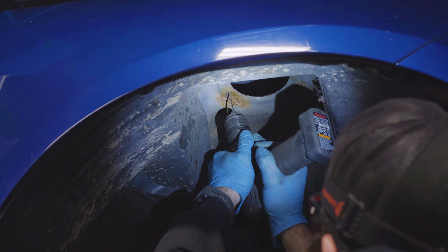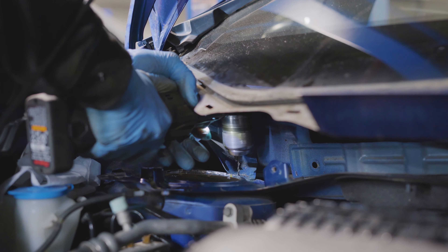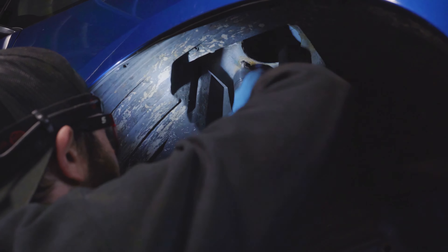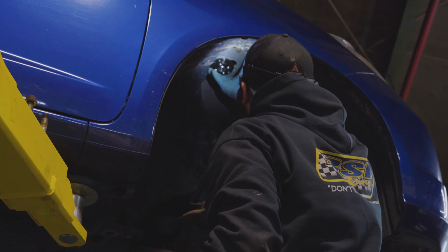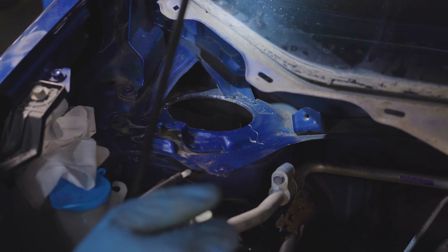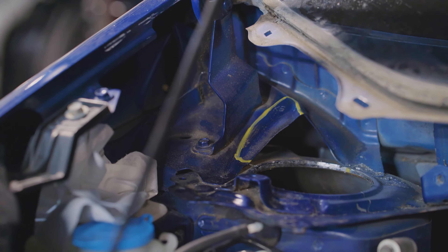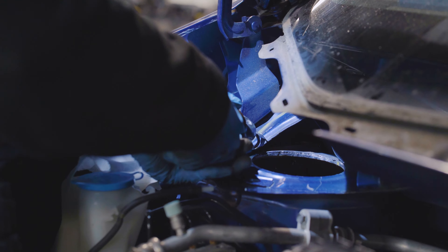When you look at the bottom of a GE chassis — the second gen — you'll see some indentations that look like they match the three-bolt pattern we designed. That's actually totally by coincidence; that's not necessarily where you're going to put the holes, but you will see those three indentations in the strut tower pressing from manufacturing. Depending on what you need from the application — targeting caster versus camber — you'll be able to change that at the time of install, so think about how you intend to use the car.